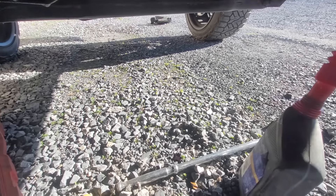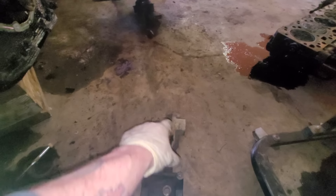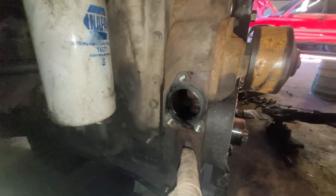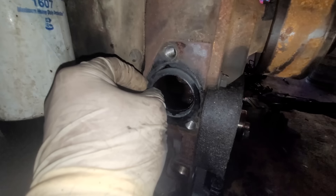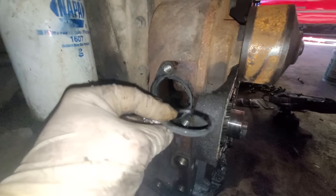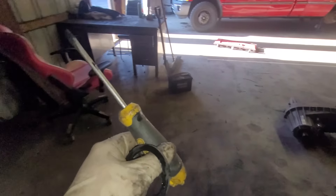Real quick — ignore the shitty quality. Right here is where the seal goes, you see this little thing right here? This is your bottleneck: AC compressor, lower rad hose, tensioner, and lower alternator bolt. There is an Allen inside of this right here — big pain in the ass — but that's your little seal right there. I'm gonna try to pull that out. That little guy literally just sits on that groove. This one wasn't leaking and I've reused them before.